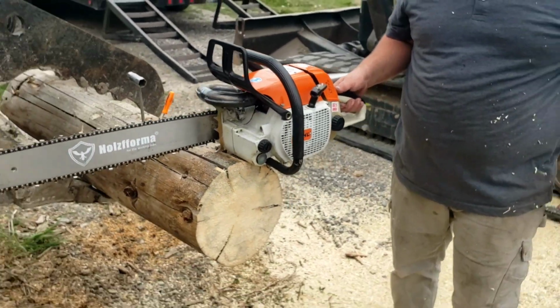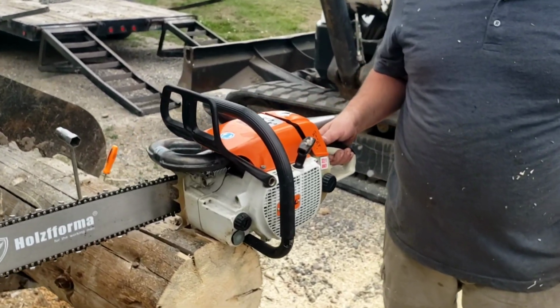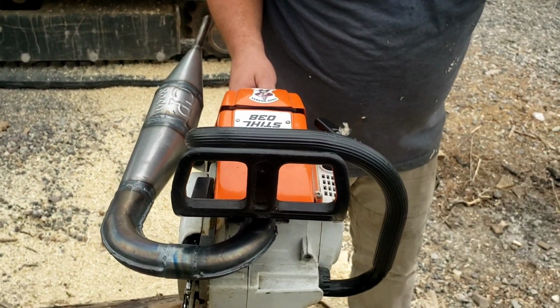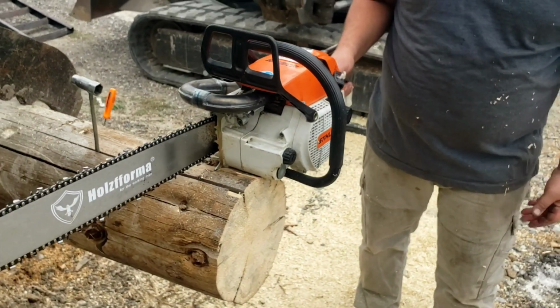I'll tell you what, at the end of the third cut, I think it's starting to lose a little more power because everything gets heat-soaked. Yep. It needs a touch more fuel. And I richened it up a little bit. Did already. Yeah. Of that first little test cut, I richened it up, but yeah.